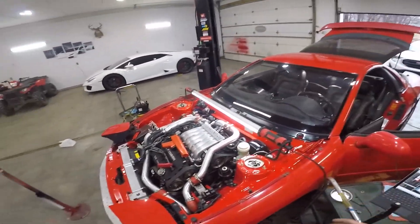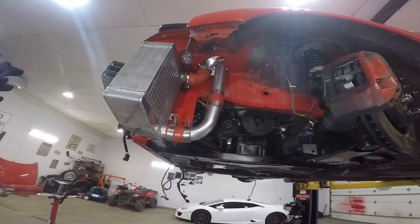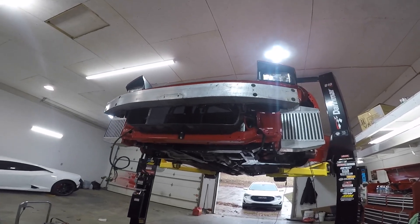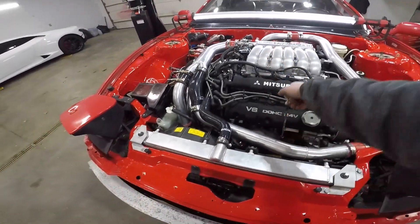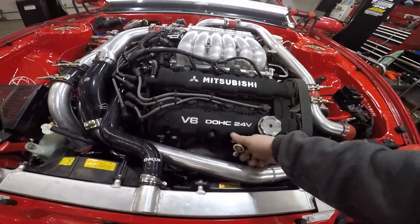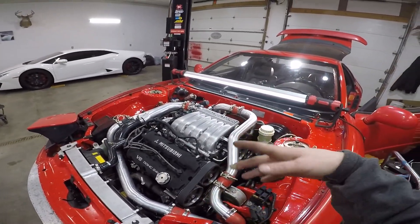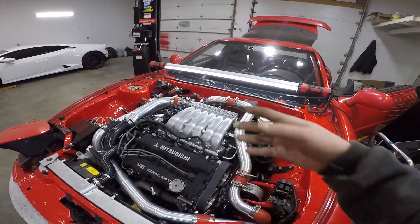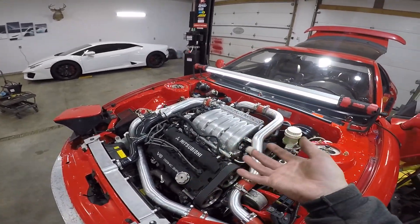I'm just gonna sit here and watch this heat cycle for a good 20 minutes. It ran for a good 25 minutes. The only thing I've got is coming out of that AN line. I'm gonna let this cool down for probably a good hour, then give it one more heat cycle before I change the oil — warm it back up for 15-20 minutes then change the oil. It's been a few hours. I put another half a quart in — right below the fill line. I don't want to overfill it because that's what everyone told me I did wrong when I had oil in my turbos. The people who built these turbos said the reason they were squirting out oil was because the oil return lines were probably blocked.